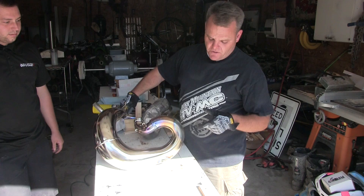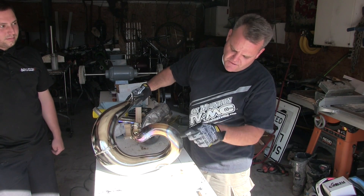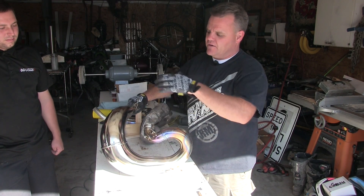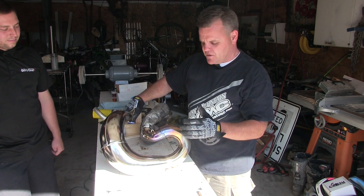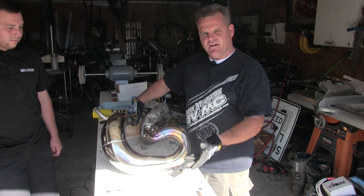That's all there is to it — our pipe is still hot and we've gotten all the big gouges out. Some of these dents in the larger mid-section can really rob power. The little ones aren't going to affect power drastically — pipe builders have told me that — but some of the bigger ones in there could really hurt your power, especially if it folds back into the frame. We're probably going to invest in a pipe guard for this pipe and our FMF going forward.